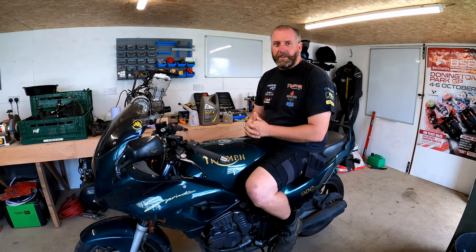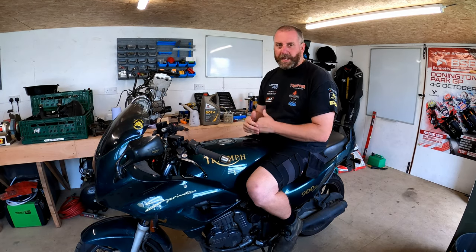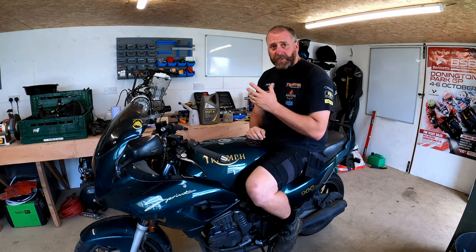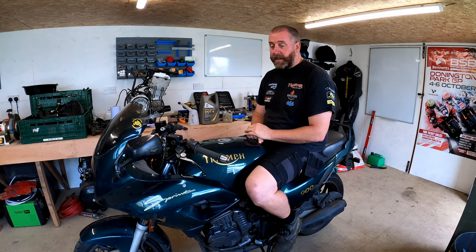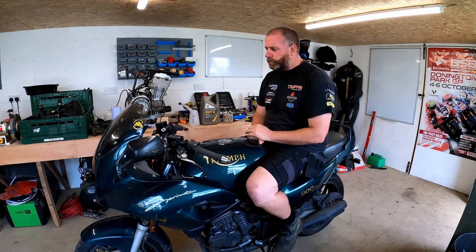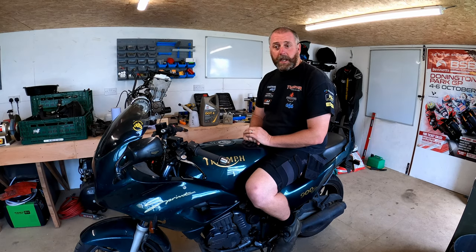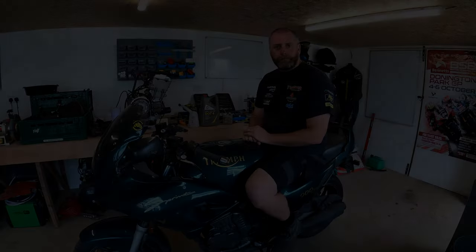Because it should be changed roughly every 2 years, give or take, or when it's particularly dirty. If you look through the little sight glass and the fluid looks absolutely boggy, it's worth changing it anyway. At the end of the day, it's your brake, so it's your life. So, thank you for stopping by. Let's crack on and get into it.